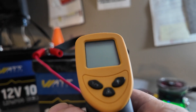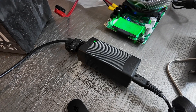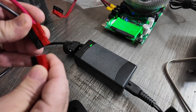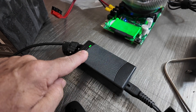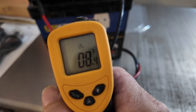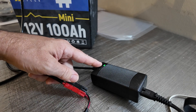This battery has been in the freezer overnight and is sitting right around four degrees. Let's test whether it will charge. As you've seen in my other videos, if the indicator light goes red it means it's charging; if it stays green, it is not charging. Connecting it — we get a green light, which means it is not charging. Battery two is at about seven to eight degrees — connecting that, and the light stays green. That's good news.